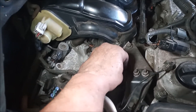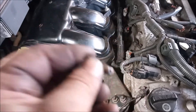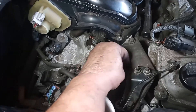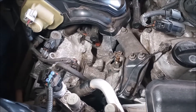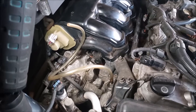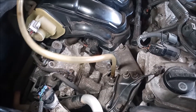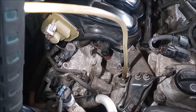Let me show you what this valve looks like. You take the cap off and inside is a needle-type valve. If you give it a few turns backwards, this valve will allow air to escape, and once you're done you can tighten it back down. To limit the mess and make it easy to visualize, I've attached this clear hose onto the purge valve and cracked the valve open.